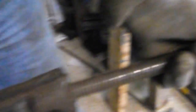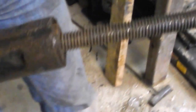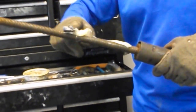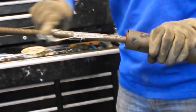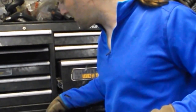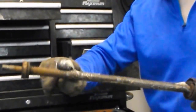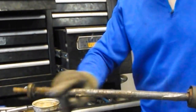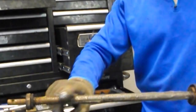You don't need to take this shaft out, but unscrew it as much as you can. The other interesting thing is this particular one has a reverse thread — it's not like a bolt with a clockwise thread to tighten it; this one is actually the reverse. So keep that in mind when you try to back it out. This is just regular automotive grease. You could get fancy and use waterproof grease since this stays out in the elements, but any grease is better than no grease, which is what it had before — nothing. So liberally coat those threads.